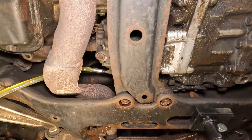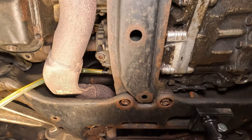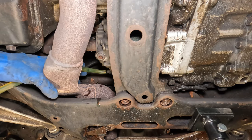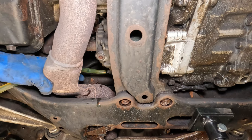I'm going to fill it up until oil starts coming out of the hole. The service manual says to do it over a period of about three minutes because it takes about that long for it to flow down through. So even if you see some coming out right away it may not be fully filled, so just take your time.